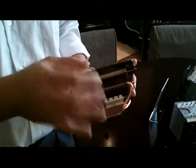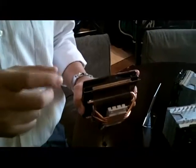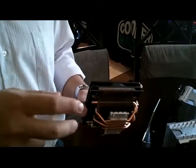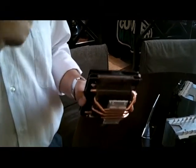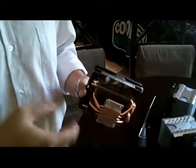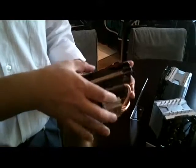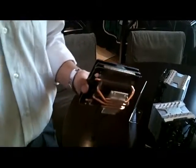59mm means it's actually shorter than the box cooler for LGA775 Intel CPUs. The Core i5 box coolers are very slim and weak in performance, so users who want to upgrade need a better option. But if they use a mini-ITX chassis, the height is very constrained, so we're making this compatible with most mini-ITX chassis.